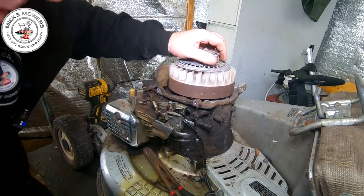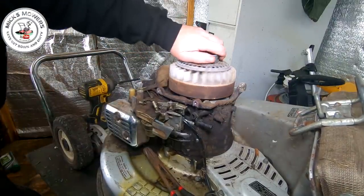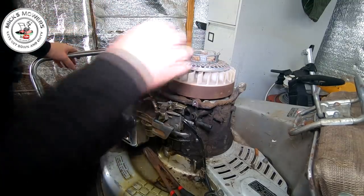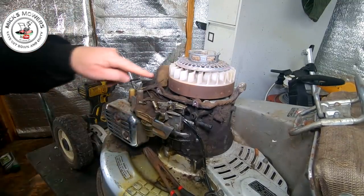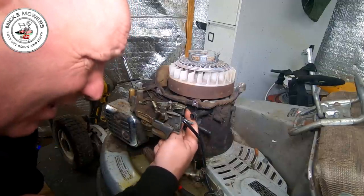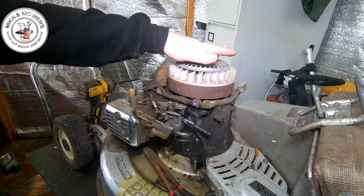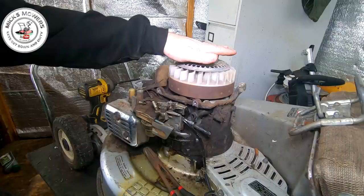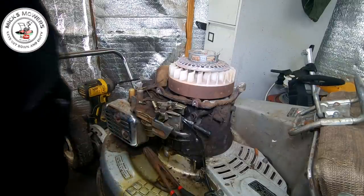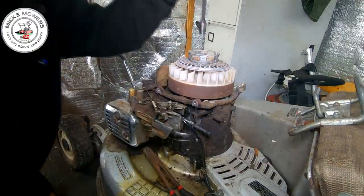Up in here we have our flywheel, which is standard. Inside we'll have all the coil mechanisms and such. Initially I'm going to have to take the flywheel off to get in here, because the coil wire comes up from underneath and goes up inside here. So the first thing to do is to get this flywheel off to expose the coil, get the coil tested, and given all the debris on here we may need to clean inside as well. That requires undoing the three 10mm bolts up here to take the cup off — this hasn't been off for a while so we could have issues.